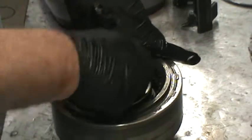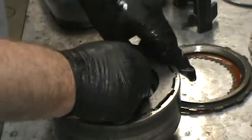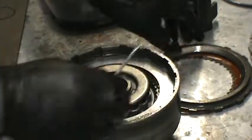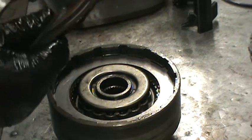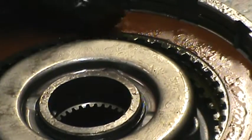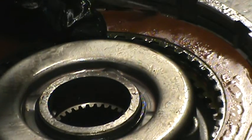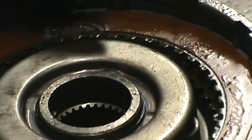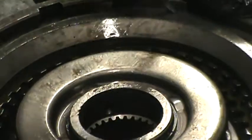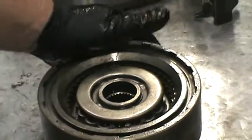So what we're going to do is substitute one of your direct steels with a forward steel, which is going to take about 14 or 15 thousandths out of the clutch pack. Now I'm feeling along in here — it's very close now, you can't feel the ridge hardly at all. The actual spec on the clearance for the clutch pack is between 30 and 70 thousandths.